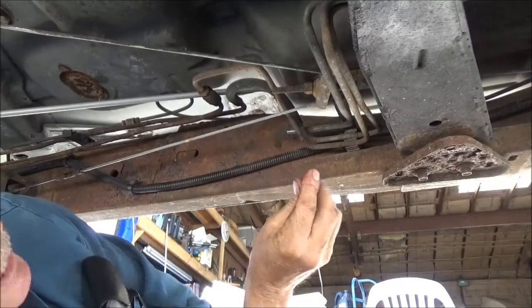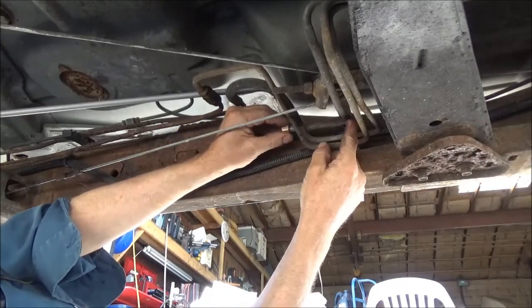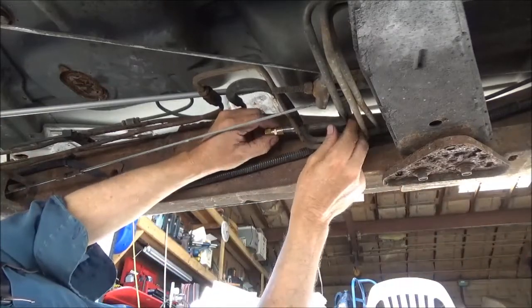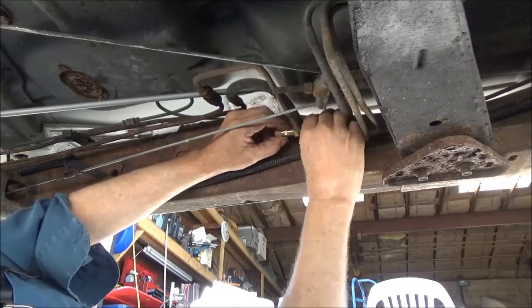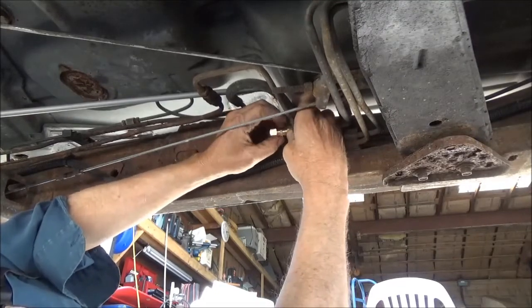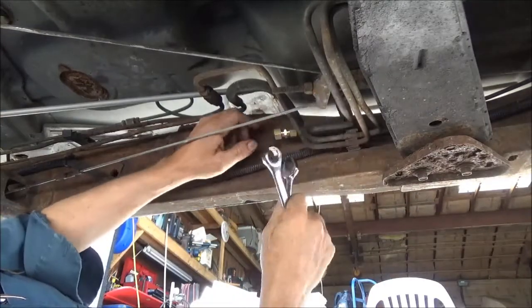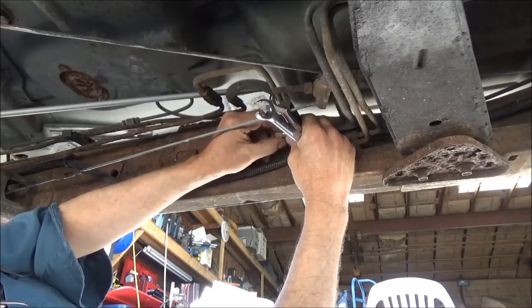These are kind of self-explanatory. How do you put them on? You put the nut on first. Slide it back there a little bit. Put your ferrule on. And then you slide this union up there. Screw the nut and the union together and tighten it on the ferrule. And you got to make sure that it stays all the way back there.